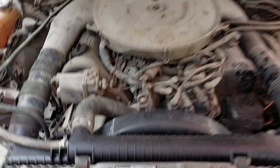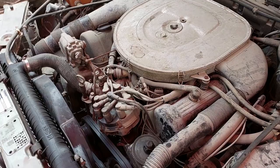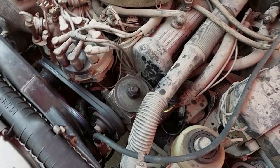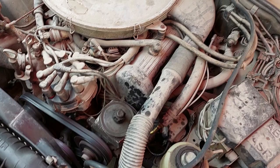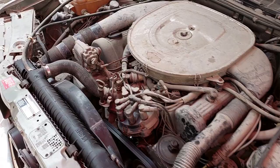The engine needs some good detailing. We'll change all the usual stuff — the leads, the belts we've already changed because they were pretty worn out; I didn't want to start it on the old belts. The filters will all be replaced, general checkup of everything. I don't think there's any issue with the ABS on this car, but we'll check it out. Already opened up the radiator and made sure that's okay. That's what the engine bay looks like.